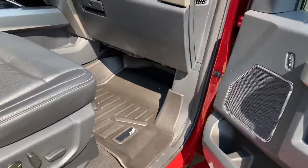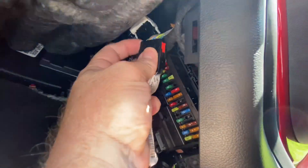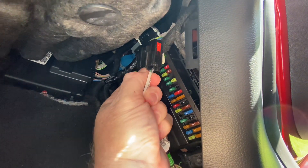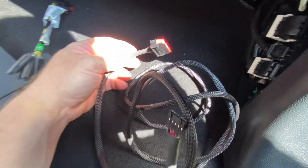Let's get started here on the passenger side. There's a kick panel that's removable down here on the lower right hand side of the floorboard. Just grab the edge of the panel and pull and it will open up. Find this cable that's a pigtail of sorts, that is for a PTO connection or snow plow. Remove that connector by pressing the detent on the removable part and pull it out, set that aside. Grab your high idle wiring harness and the larger connector connects into the factory receptacle just like this.